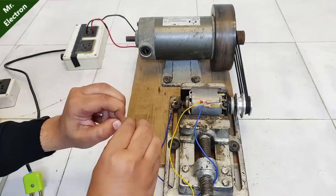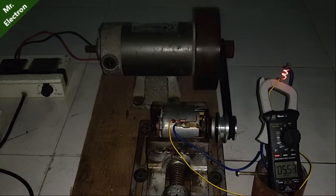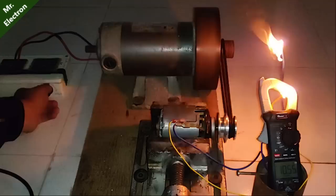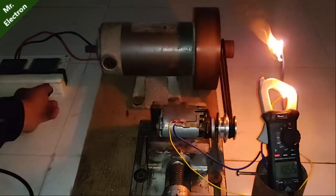Now comes the shunt resistance short-circuit testing. I'm going to short-circuit the wires using an external shunt resistance with really small loops. At minimum RPM it is drawing around 5.5 amperes and glowing hot — almost red. Increasing the RPM, we've easily reached 8.5 amperes and it is smoking red hot. Let's go further — it has caught fire! The filament burned out and broke — the shunt resistance burned out.